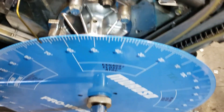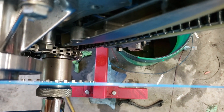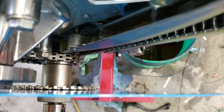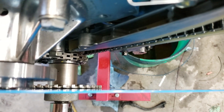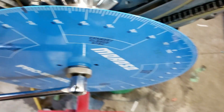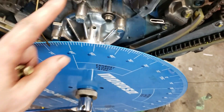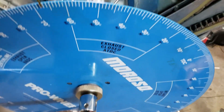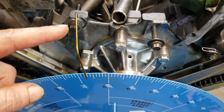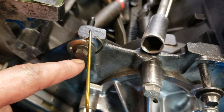First step is to go ahead and get your crank socket put on there. I used the crank position sensor wheel down there to give me a little spacer to clear this water pump, but you can use whatever you got to space it out just a tad bit to clear the water pump. Put your wheel on there and tighten it down so it's steady and doesn't move. Get your pointer — I just used a coat hanger that I bent and fixed it where the alternator goes.